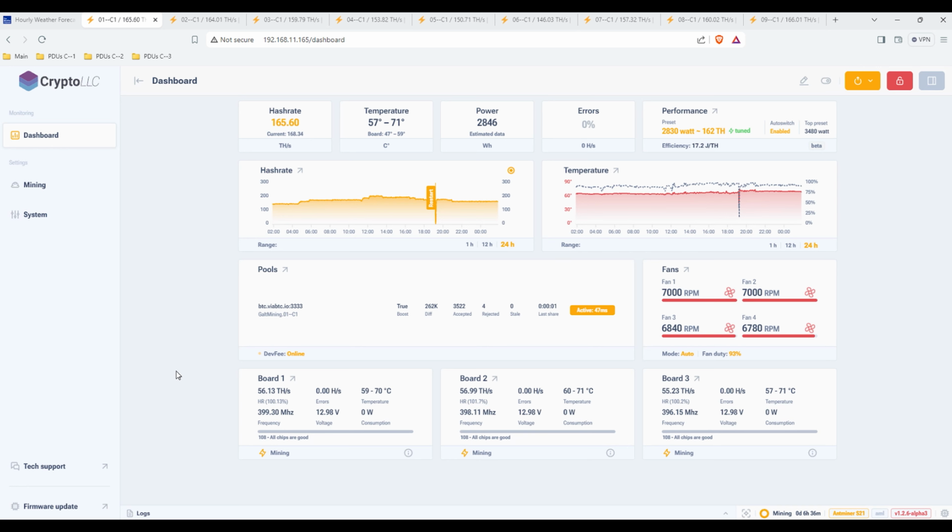So in this video, again, we're talking about the firmware we're using, the pluses and minuses. There actually are no minuses to using this firmware. It's great. It saves you wattage versus stock. If you take Bitmain and you just run their stock firmware, Vnish, or Luxor or Braiins or other types of firmware, they all do a better job than Bitmain. They all provide more performance or more savings in wattage. So you're always going to be better off running custom firmware.